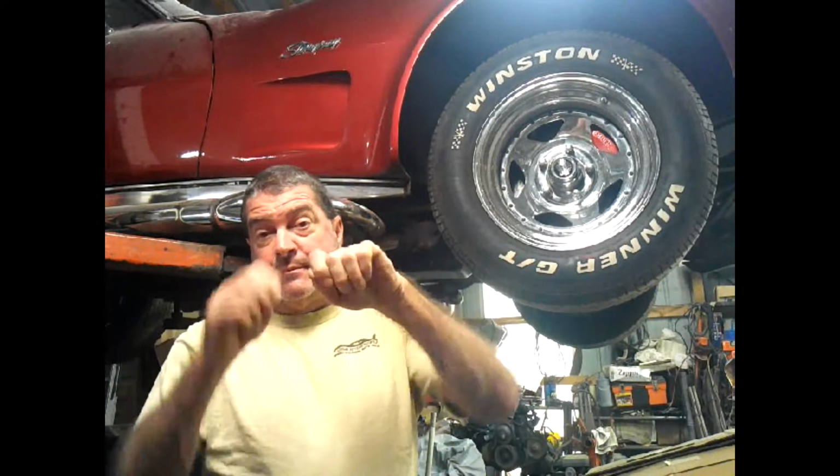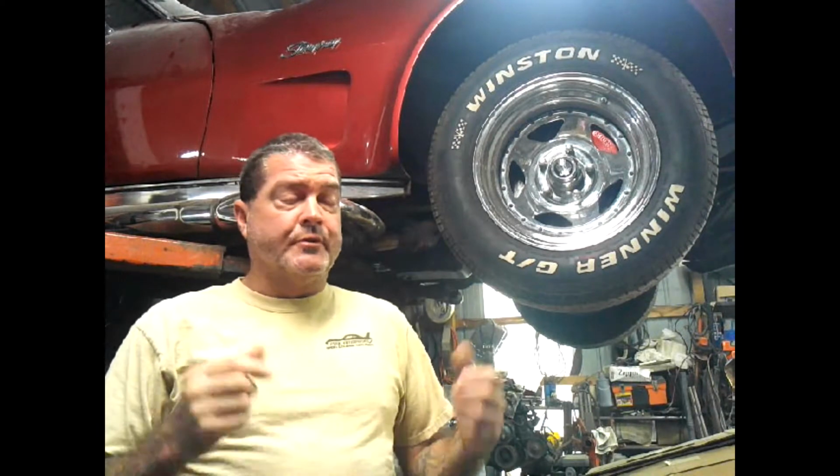I've actually forgotten the bleeder open overnight on the other side. And came back in, and it had just barely dripped. So I wouldn't make a mess, I put a little hose in a can, and I did put maybe this much in the can, and it was a small can. I closed it off because I just remembered it was early morning, like, oh shoot, I left it open. So I ran out here and shut that, checked it later, and the reservoir had only gone down an eighth of an inch or so, a quarter inch, and so it was no big deal.